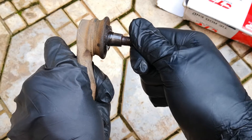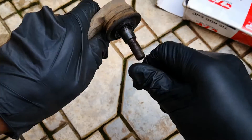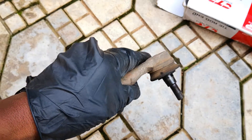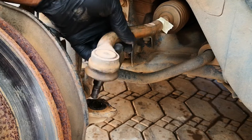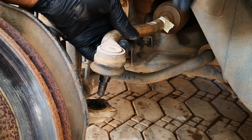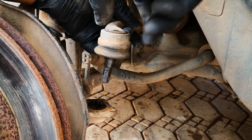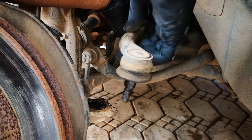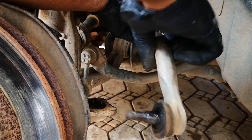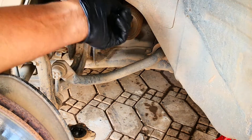That's a lot of movement. The severity of wear can be checked by the presence of vertical movement of the stud — that is, in and out of the joint — and there's none here. If you do have that, the car is not roadworthy and should be repaired ASAP. Some people count the number of revolutions it takes for this to come out as a way of knowing how many revolutions to turn when installing. I'll count as well — it comes out at about 15 revolutions.